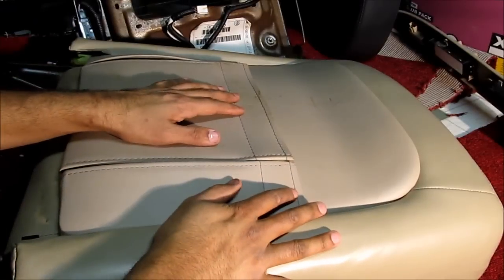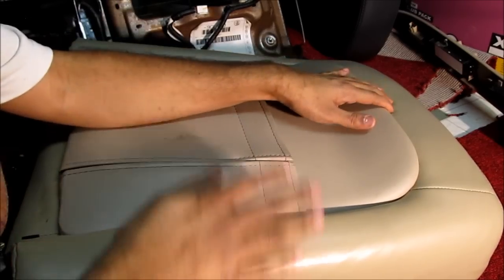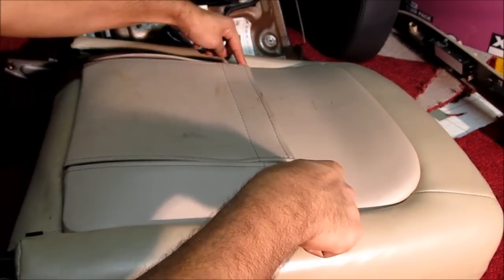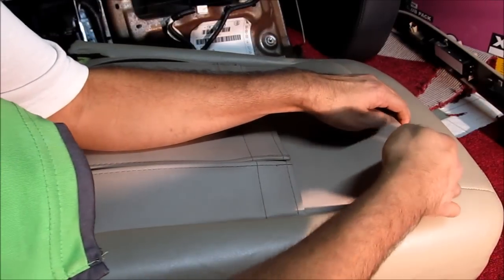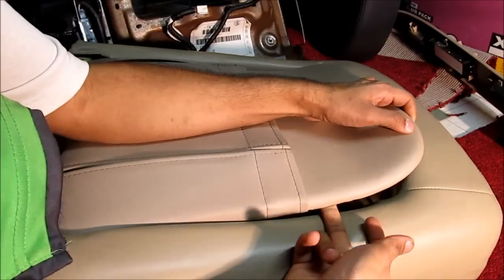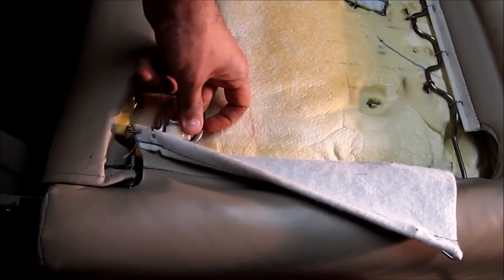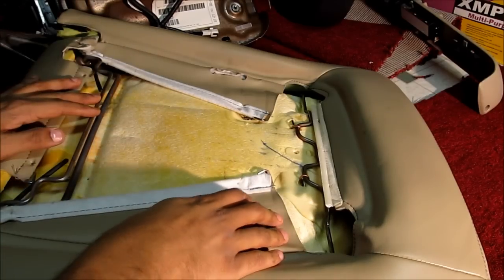Here's the chair back from the Lexus. To add the seat heater, I'm going to need to remove the leather covering from the chair, starting at the back. There are six clips that hold this back panel on — two at the top which are easy to get off, two on the sides which are really hard to get off, and two clips at the bottom. We're going to start by gently prying up at the front, then get in with a screwdriver to disengage the clip, pull it away, and it will come off. Don't forget the wiring harness for the lumbar support before you remove the top of the seat. At the back of the chair there are a few hog rings that I've already removed.